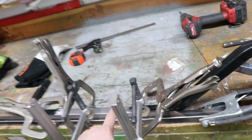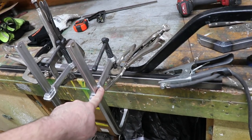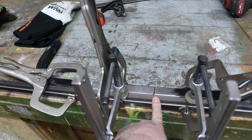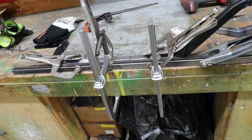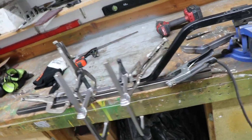And because I got it clamped to the table separately from clamped to the parts, I'll be able to loosen it up from the table while still keeping it clamped to the bar for welding two more sides. And then I only have to remove the square tube that I'm using as a jig to make the final side welded.